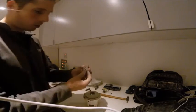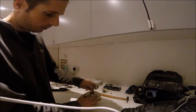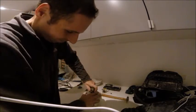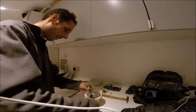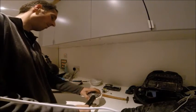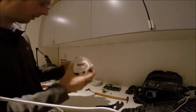Put the impeller back on top of the washer, then put the other washer on top, reminding myself that the concave piece is underneath. Put the bolt back on top — the bolt screws up anti-clockwise. As you get it tight, it will start to turn the motor, so find the place where you clamp it and clamp it again. It does damage the impeller slightly on the edge but I think it's a price worth paying. Tighten it up — that's tight. The impeller goes round, the bearings go round, and it feels good.